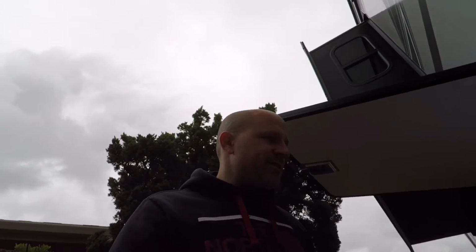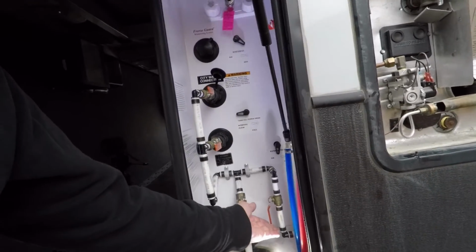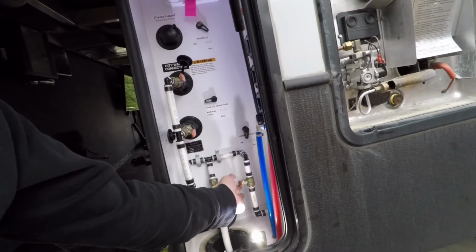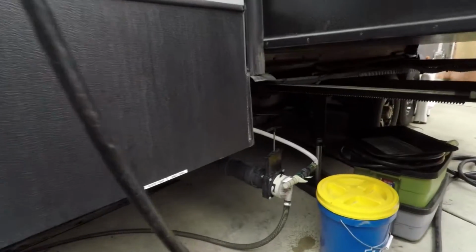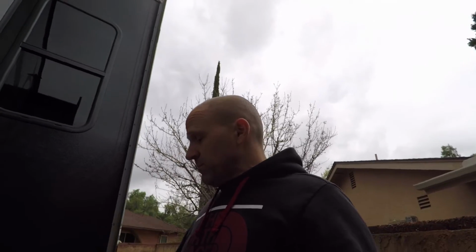Okay, so black tank is empty. Took about 8 minutes, I guess, maybe 6. So I'm gonna throw on the flush. I'm gonna turn this off, get a little stronger water pressure in there. See the one-way valve kicking in. Let that run with all the gates open for 5 or 6 minutes. Maybe do that once or twice, depending on how long you've been sitting. All done.